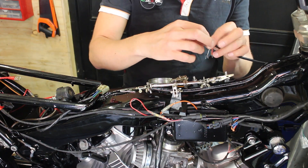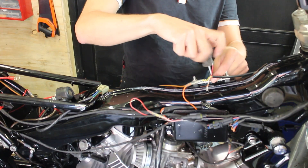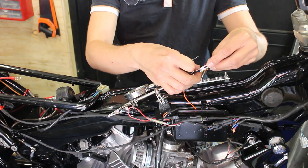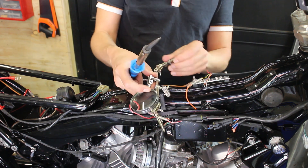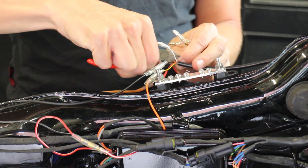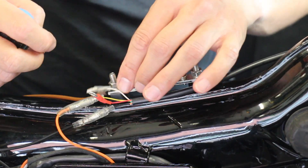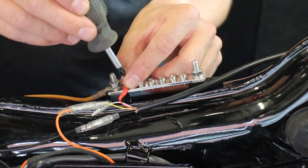So there is our RPM signal wire. We are here anyway, so let's connect that red wire straight to our distribution bus, which distributes the brown 12 plus wire. In the meantime I gave the meter a ground wire straight to the back. Later on I decided to make a distribution point for ground on the frame in the front, something I hadn't decided here yet. This is that positive wire connected to the distribution bus.